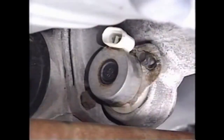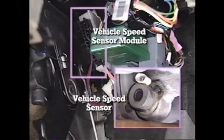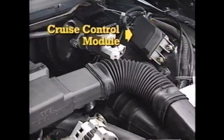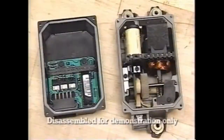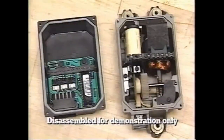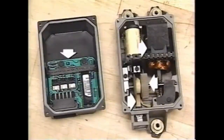The vehicle speed sensor and the vehicle speed sensor module supply vehicle speed information to the cruise control module. The cruise control module is normally a unit replacement; however, a quick look inside will help you understand the characteristics of the electromotor system. The module houses the cruise control electronics, the stepper motor, a gear set and clutch, and the connecting strap.